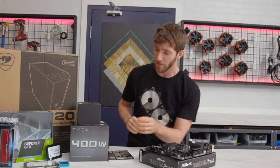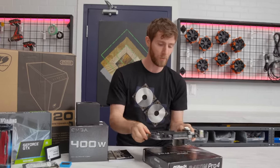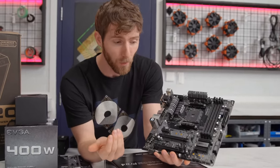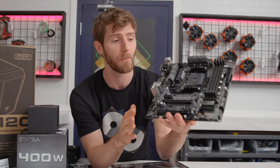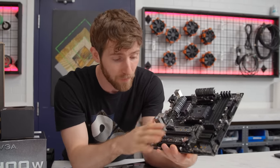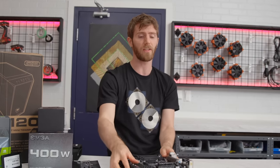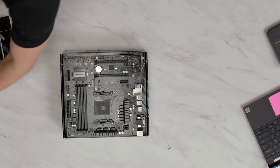For our motherboard we went with the ASRock B450M Pro — just a great balance between performance and cost. It's mATX, so you don't get the expansion of a full-size board — only three PCIe slots — but on a B450 board you don't have the same chipset features anyway and mATX is a really good compromise. We've got socket AM4, four memory slots, two M.2s, and a reasonable I/O mix with six USB 3+ ports. Only gigabit Ethernet though — it's not until B550 that you start seeing 2.5 gig Ethernet on these value-oriented boards.